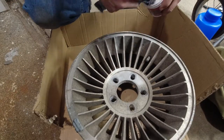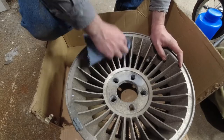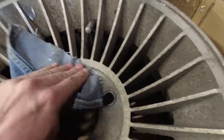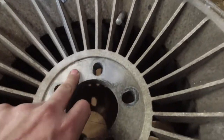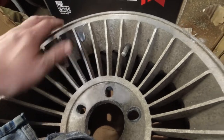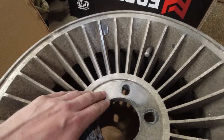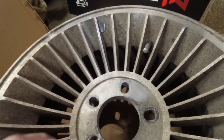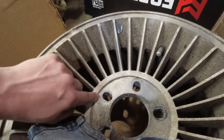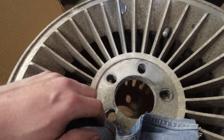In fact, let's try that right now. I did a quick and dirty job of polishing right here and it's definitely gone from full satin to really shiny with just a quick shot. I did this one spoke here and same thing — it's gotten actively shiny. I went at these with a fine fiber disc and got a pretty good result too, so I think the blaster is going to be most useful for getting in here and all the places where it's hard to get an abrasive disc in. I'm really happy with that for not a lot of effort.